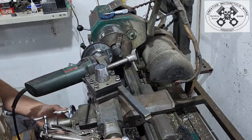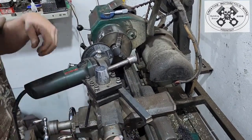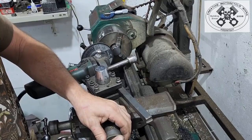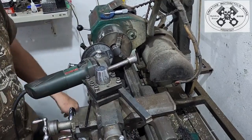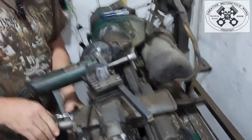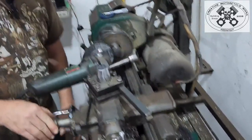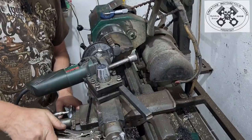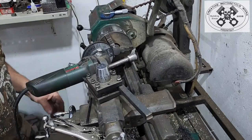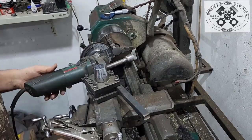Stand by — I had a bit of lag here. If there's lag, you need to take your lag up first. Set that to zero again. There it's on zero. Run it again, bring it in until it's touching, then lock up the saddle. So the saddle's locked and the cross slide is engaged. Let's back out slightly and start.